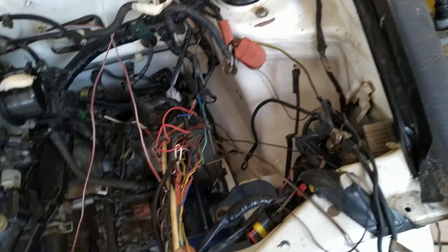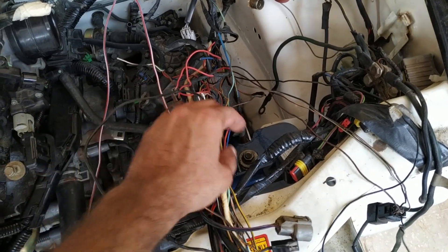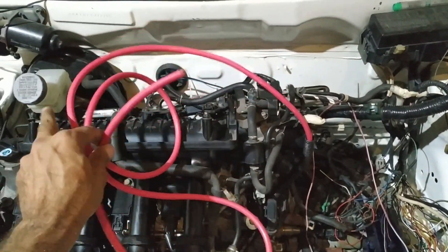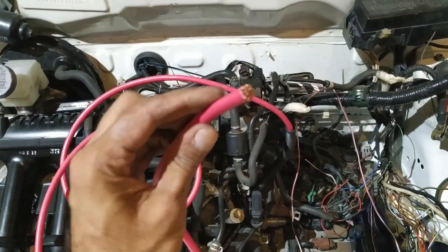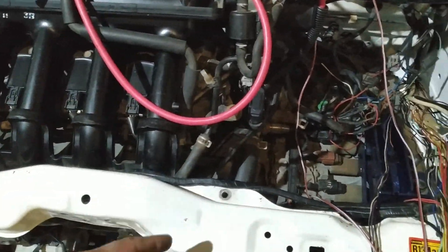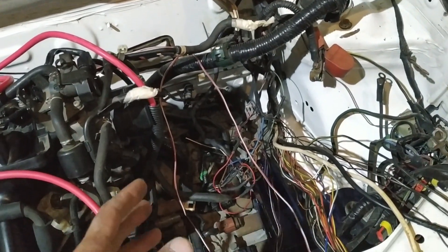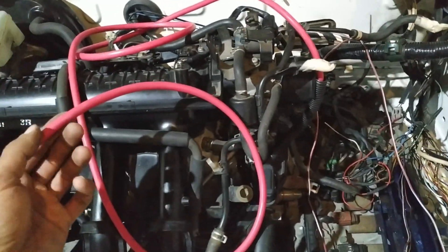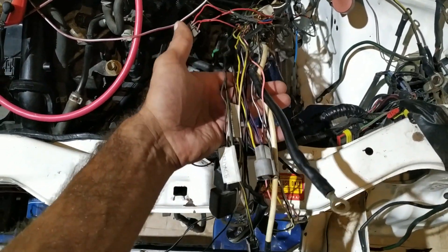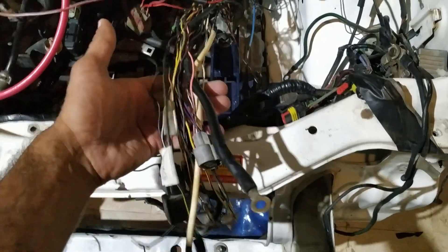Some body-side related wires will be found here, such as the radiator fan, the temperature sensor, etc. This is the wire I'll be using for the 12V main power line, which will be used with the generator. It is a pretty thick wire, because the battery will be relocated to the trunk of the car. In addition to the already present wire, I will be adding this, running all the way to the battery in the rear, so that the voltage drop is minimized and the voltage is very stable. I have sorted the original loom, tagged the wires, and cut off the excess ones. I'll only be keeping the wires I need.